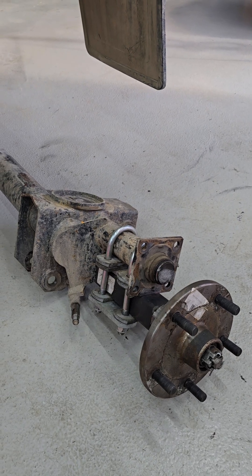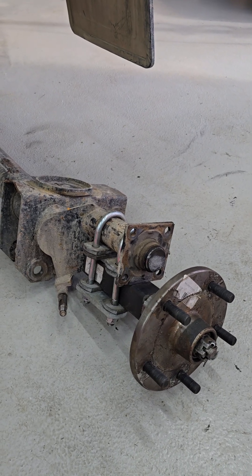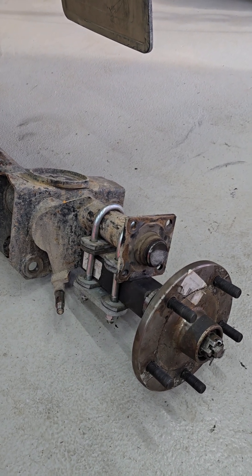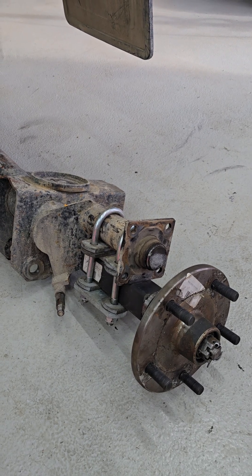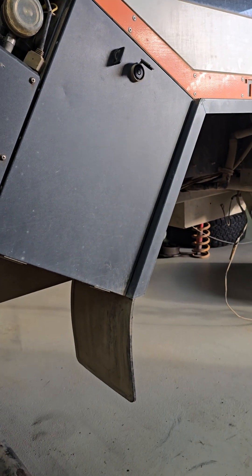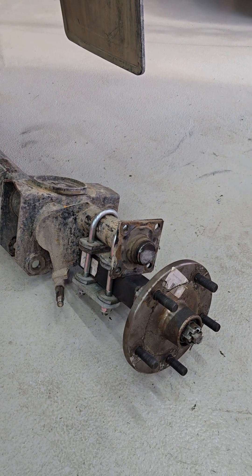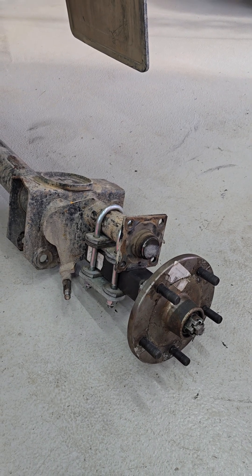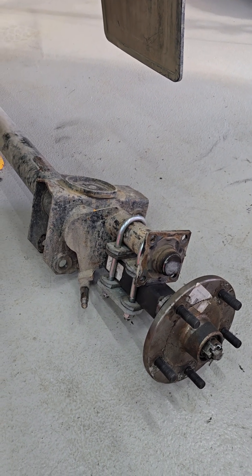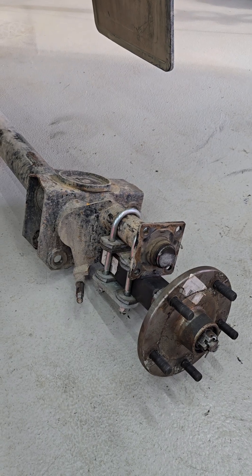This is probably a good time to highlight the dramatic expense that can come from this failure, and this is why I'm making this video. Whilst I say this is common — it seems to be once a month — I don't know what the actual number is because we're just one repairer, but it's too many. You're typically in the middle of nowhere. The van needs recovery and repair. There's freight times, especially between the eastern and western sides of the country. The damage to vans can be really extensive — this whole back end is often just wiped out — and so you're talking about numbers well north of $20,000. If it's in a Mark III, you pretty much write a van off as a result of a stub axle failure. Not saying it's going to happen to everyone, but it's common enough for me to make this video.